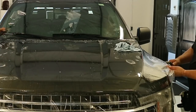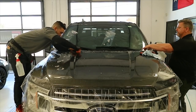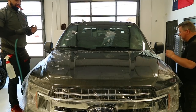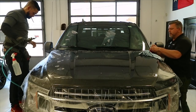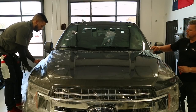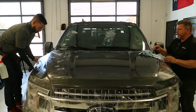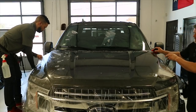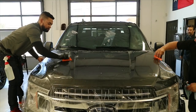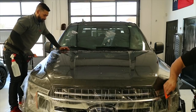Put a little slip down in here. When I get to a corner I don't just let it rest on top — I like to get the corner locked down. Nothing worse than letting a corner sit while you work on the rest of it, and when you go to put it down it leaves a line where it's stretched out. A little alcohol there to lock it down, then come back and squeegee on top of your body line — don't leave a moisture pocket along here.